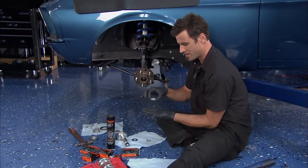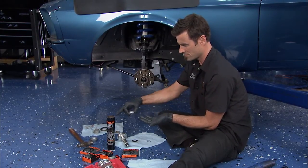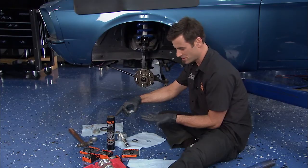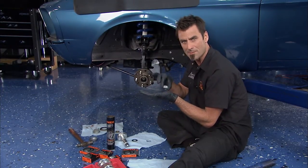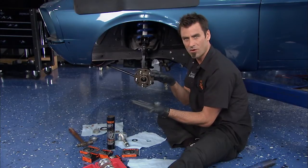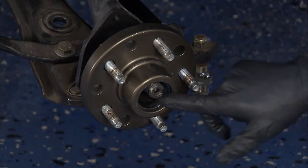Now the front — I've already packed that bearing. A lot of times what people do, put some grease on. We've got a special racing grease here we're going to use — that's also from Timken. Put some on, push it in until it goes all the way through the bearing. So we've got the bearing packed.